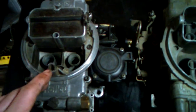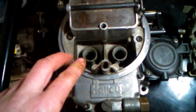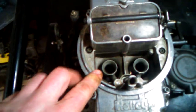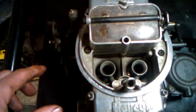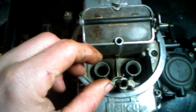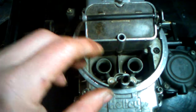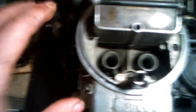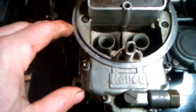But if you get into the next level of modifications with unheated intake manifolds, the annular booster carburetor is what you want. Without heat in the intake manifold, your fine homogenized liquid droplets — your good air/fuel mixture in liquid form, not vapor — are going to pack more energy to burn into the cylinders.